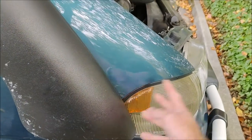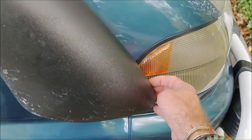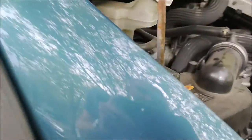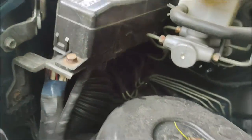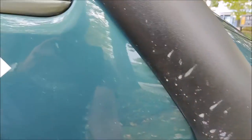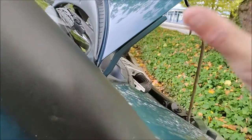There is a fifth mounting point — this is for the later generation Delica, same L400 model, but they had a facelift and the headlights are different. Most kits you see come with just this one style. That additional mounting point you obviously do not use because it would go through the lights. So I put those four studs on there, banged it in, pulled it off, drilled my holes, and then went in from the inside with nuts. Trust me, they're there. It comes with a flat nut with a washer style. None of the nuts are in the engine compartment — they are all inside this fender. So all of them have to come through the upper wheel well. That was quite a reach to get your arm around through here and all the way up to the one that's right in this area. Got a nice long ratcheting wrench up in there, but it did work. Bolted really tight. Got it nice on there.